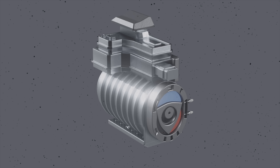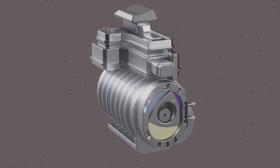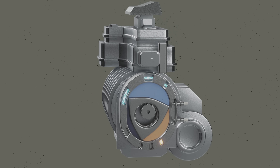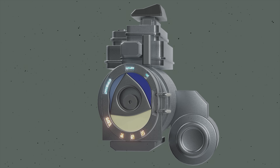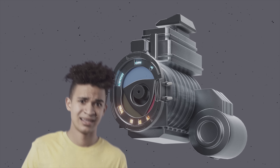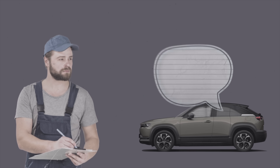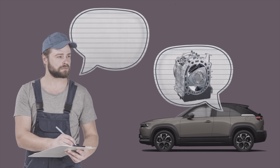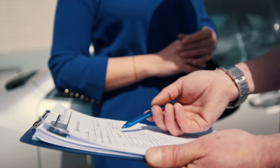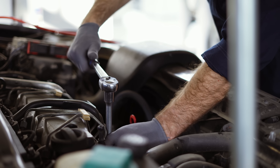Another thing that impacts emissions is rotor sealing. The intake and combustion occur simultaneously but in different parts of the housing, so the top of the housing is cooler while the bottom is hotter. This uneven temperature makes sealing much harder. You can use coolant jackets to help even out the heat load, but you can't eliminate the problem entirely. And because the rotary engine is more rare than common, it's not easy to find parts when repairs are needed, and you still need a mechanic skilled in fixing rotary engines — and sadly there aren't that many of them.